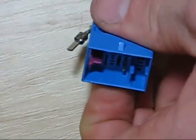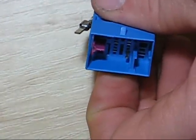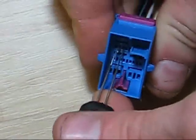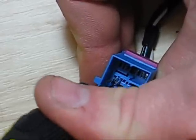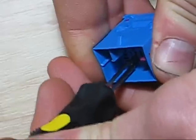When you insert the tool, you're compressing the barbs so that they can fit through an opening. Those barbs' job is to keep the terminal in place. What happens is the barbs get butted up against the terminal housing and bite into it so they cannot be compressed. By pushing the terminal further in, you get the barbs away from the terminal housing so you can compress them more easily.